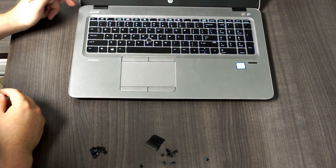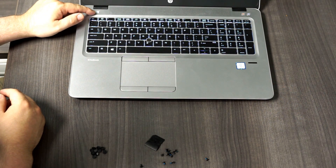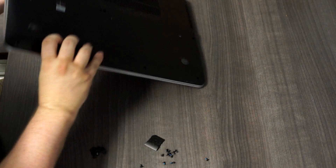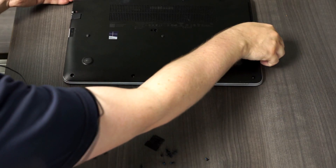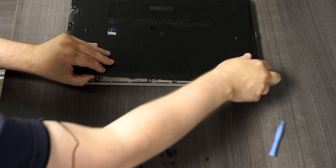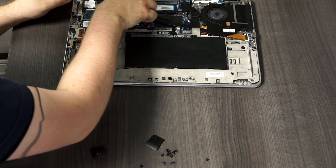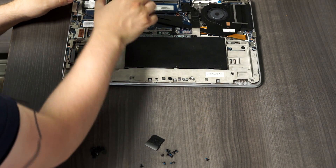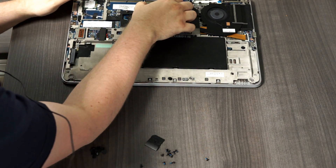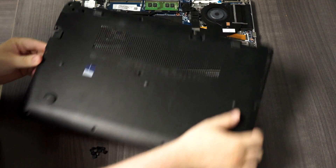Initially when I first got this one — got some beeps now. That's not what it was doing originally, but it might have had a weak battery when I first got it. Originally the lights would come on and then just flash right back off. This feels really floppy and loose, and this memory chip looks fine — maybe there's something loose in that DIMM. Let me put it back over here. That feels tighter, there's less play in it. So maybe there's something wrong with that DIMM.